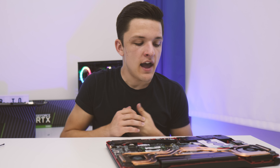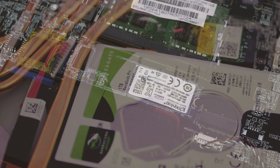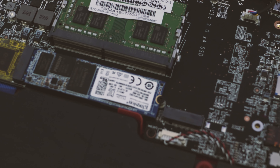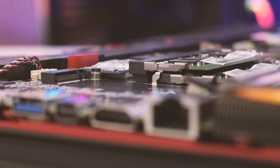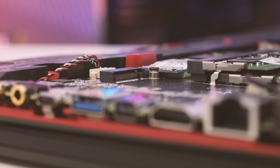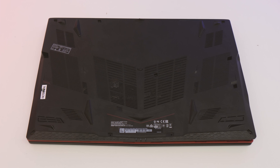On this motherboard we've also got a one-terabyte Seagate Barracuda Pro hard drive — a 2.5-inch drive providing mass storage — alongside a 128GB Kingston SSD M.2 drive in this particular model. It also has a PCIe 3.0 x4 SSD slot that's unused, so you can pop in another M.2 2280 drive to expand storage even further or upgrade the existing drives.